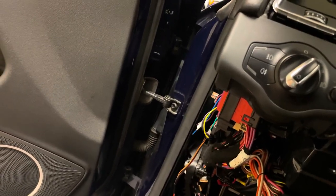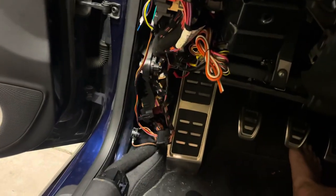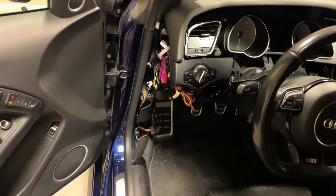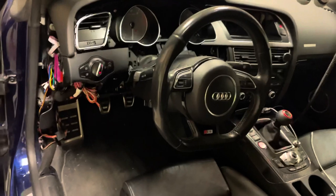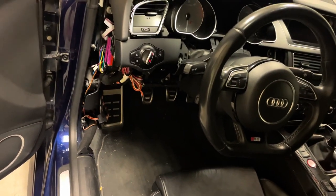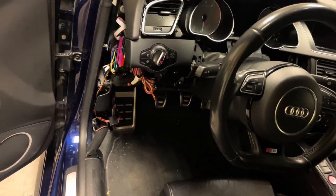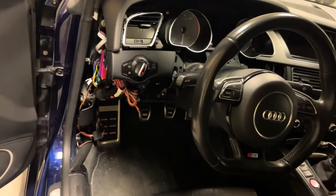When you come back, I set mine to lock-lock-lock on the OEM key and it starts up. Mine is set to three minutes — if I don't get in after three minutes it'll turn back off, but you can set it longer. Once you have everything wired, just follow Fortin's guide directly. As long as you follow the instructions, flash the module properly, and plug everything in properly, it should work. Plug the battery back in once everything is wired and you've already flashed the module, then put the module back in, decrypt the key, take it back out, put it back in, and it's ready to go. Once you test it and confirm it works, put the interior back together. There will also be a written guide with pictures. Really, it's just three wires to solder, two to screw in, one wire on the EVO ONE to connect to itself, then configure it on the computer — and you're done.